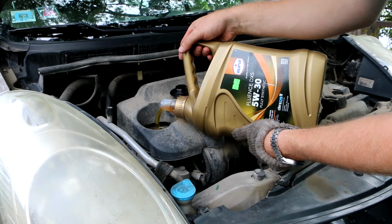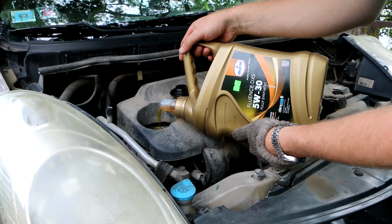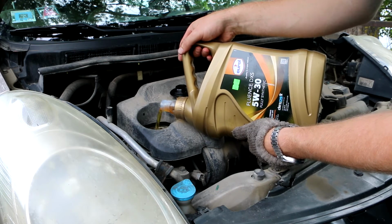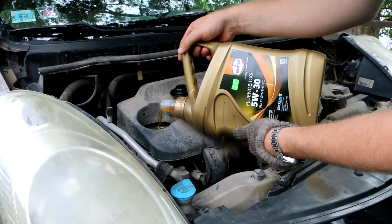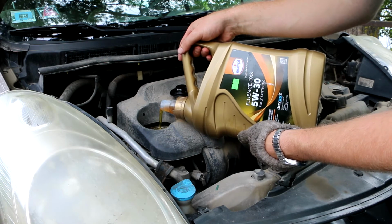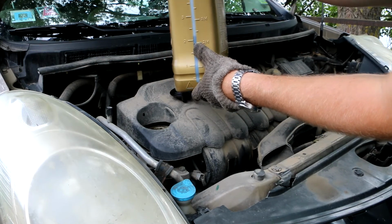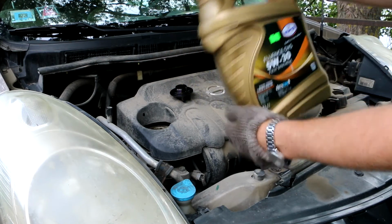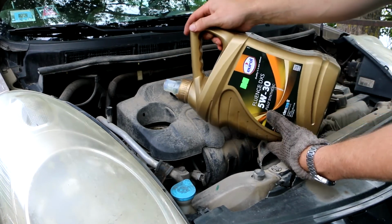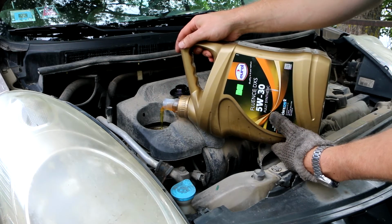So you will definitely have some leftovers when you buy a 5-liter oil can, and sometimes it's useful because oil sometimes just evaporates, and then you need to just top this up, and this will be good for that. You can inspect how much you have filled in while you're filling it in, and you see right now I filled about 3 liters, so definitely something more. But you also need the special inspection tool to check how much oil there actually is. You can start checking it when you have filled about 4 liters.